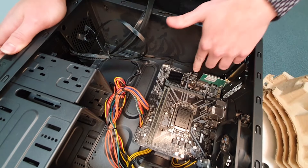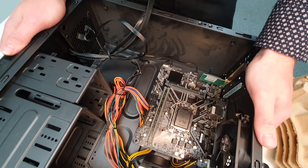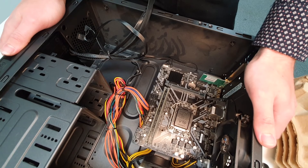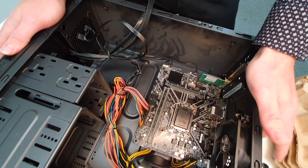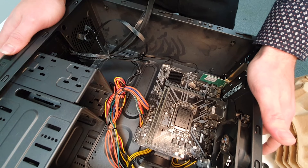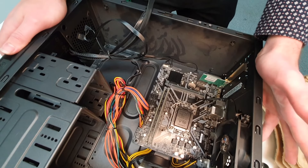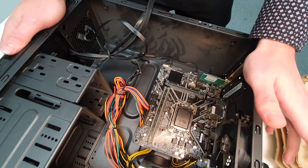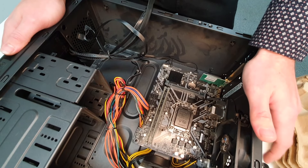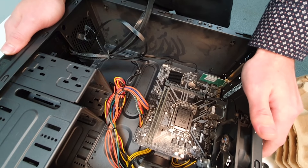The first one is very simple. You'll see a battery here which resembles a watch battery. You can just take this out for a couple of minutes and that will reset your CMOS when you put the battery back into the motherboard and turn the PC on. A few reasons for doing the CMOS reset is if you've lost display from your graphics card or need to reset your BIOS. A few other issues could also lead to you wanting to reset your CMOS.